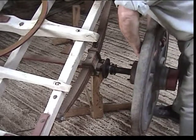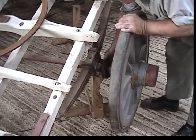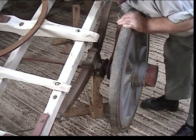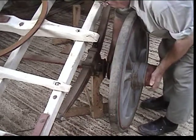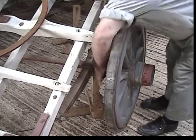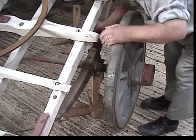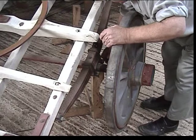Lift the wheel on there. Slide into place — it picks up. Put the soft washer over it. On a heavier vehicle there'd be more of a crash bang fitting the wheel. Slide the wheel into place, pick up the inner rim that retains the wheel — stops it coming off. Three bolts there. Just put these on lightly for now; I can pinch them up later.